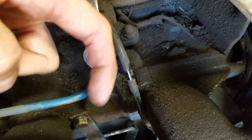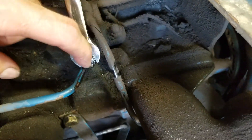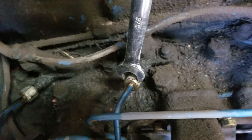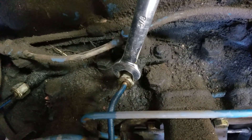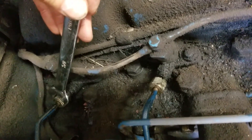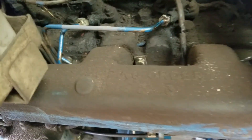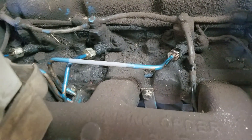No bubbles — you should basically see squirts come out, then you'll know it's primed. Moving on to the last one: by the time I get this one bled out, it starts sputtering on about two cylinders. On the third cylinder you can just about crack it and close it, and usually it's primed. Once it starts to kick over it bleeds a lot faster, so that third one you can do it quickly.